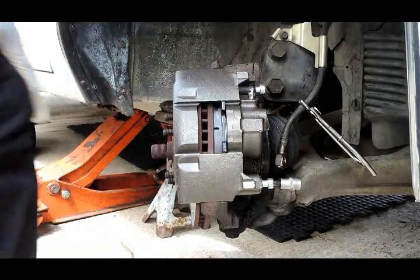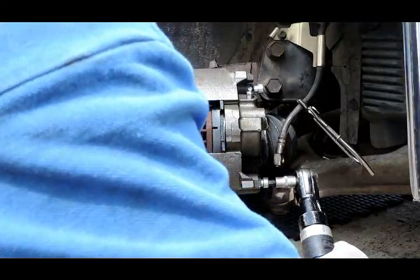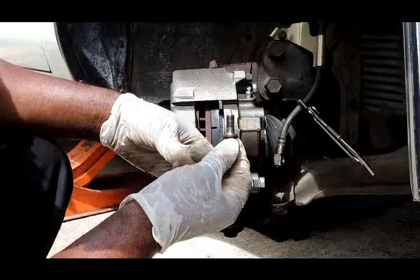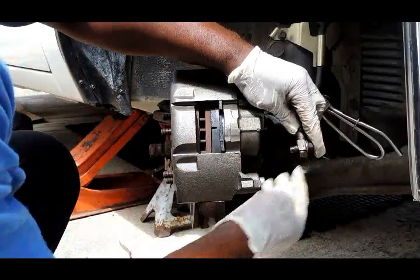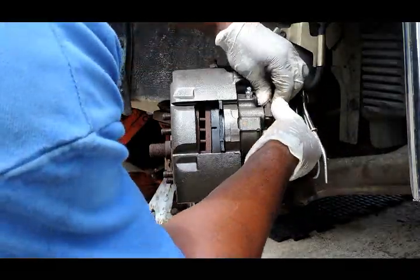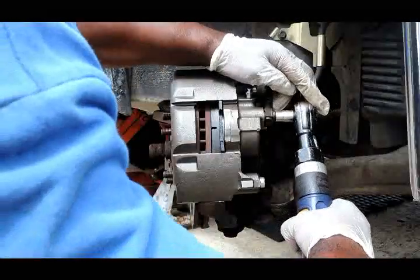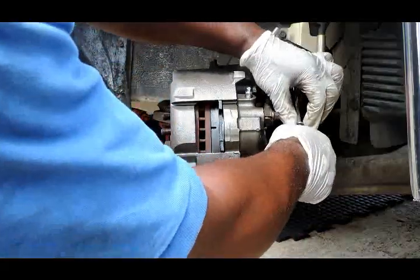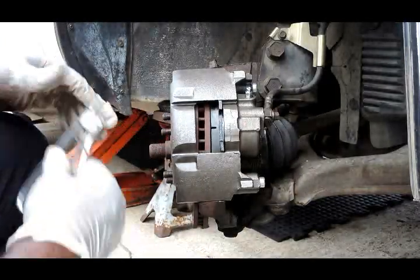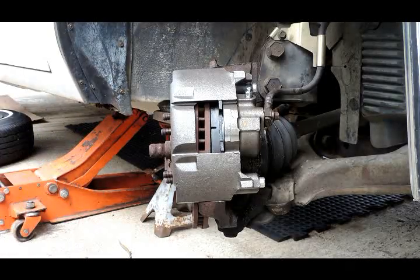Okay, let's get those tightened up. Okay, took that washer off of there. Slash gasket. Put one on. Put it through the brake line. Put the other one on. Now we can take our tool off, release it. We're not going to bleed this yet. What we're going to do is set up, and let's go do the right rear brake.